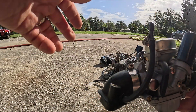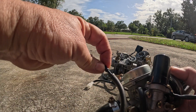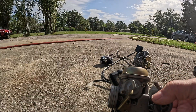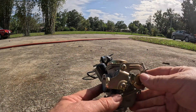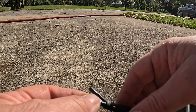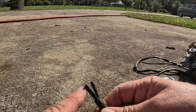If you have a stock Mad Dog, you're going to have a line coming up from the vacuum. It's going to go to the vacuum fuel pump, but it also tees off and goes somewhere on the carburetor. So in this case, I left the line here and capped it off where it goes to the vacuum fuel pump — same method, just cap it off, you do not want air getting in here. You may find it already capped; that's fine, cap off everything. You may not have that if you have a 50 — no vacuum line going to the carburetor, and you can see this 50 has nothing on it. But the important thing is: if you have that stock manifold and that line comes off, follow that line — it doesn't just go to the vacuum pump, it tees off and goes somewhere else. If we cap off here and leave the other end open, we're still sucking air into the intake manifold. You can't have any air getting into this line.